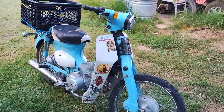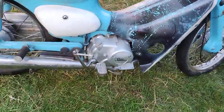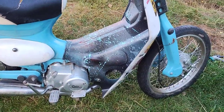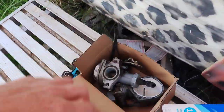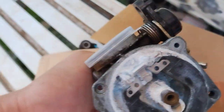I called someone with a truck and I was just amazed I got it back. The ignition was missing, so I took the ignition from a parts bike. It just wouldn't start — I kicked it and kicked it and kicked it, sweating in the hot California sun, then pulled the carburetor off.